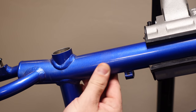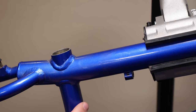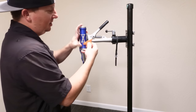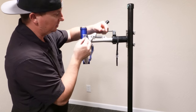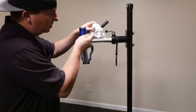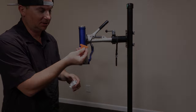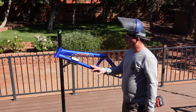On the frame there's some duct tape residue and I'm going to need to wipe the whole frame down. I might use automotive brake cleaner, rubbing alcohol, goof off, or a combination of all of those to get all the adhesive stuff off and get it totally clean. I'm not particularly proud that this is a brand X frame and I have no loyalty to the brand, so I'm going to remove the head badge as well. Most head badges are just held on with double-sided sticky tape. These plastic razor blade tools called safe scrape blades are super handy — they turned out to be one of my all-time favorite tools. I've also decided to remove all of the cable guides and replace them with some stick-on ones to simplify things and look a lot cleaner.